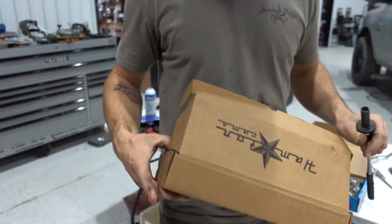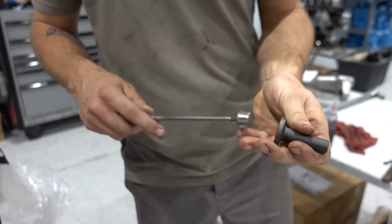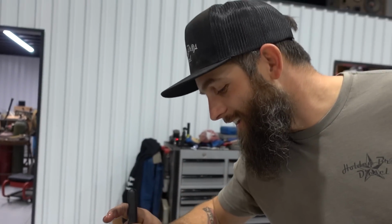So for a cam in this setup, we're running a 188-220 cast cam in a set of Hamilton's 1.5". It might be like 145. A little bit bigger than a stock tappet. The lobe has a greater contact surface, so they just work better, and that's what we do. We put the lotion on its skin. Exactly.